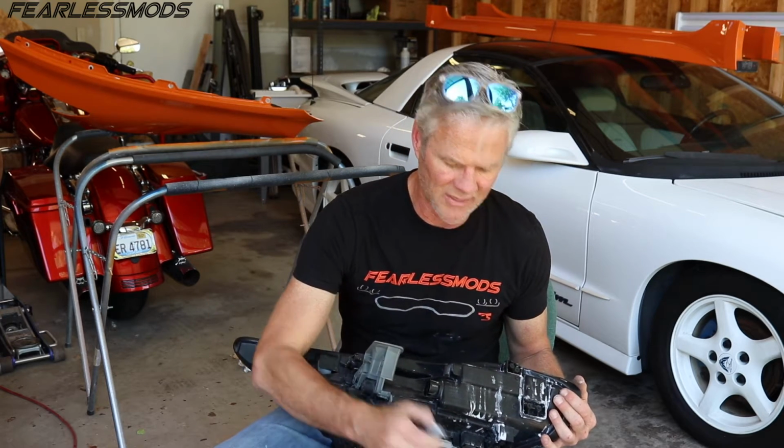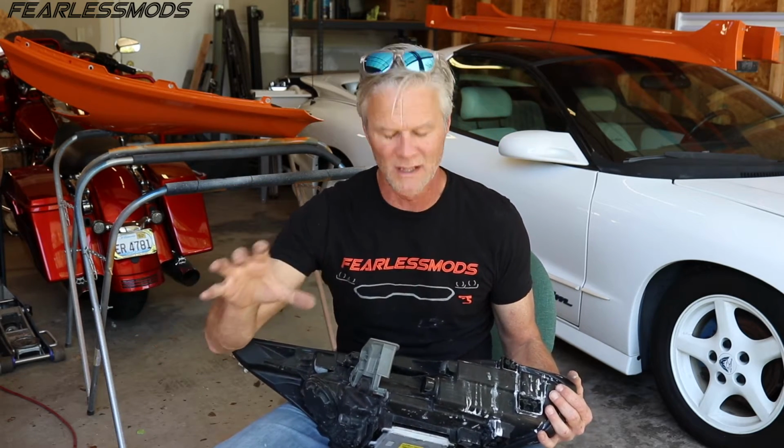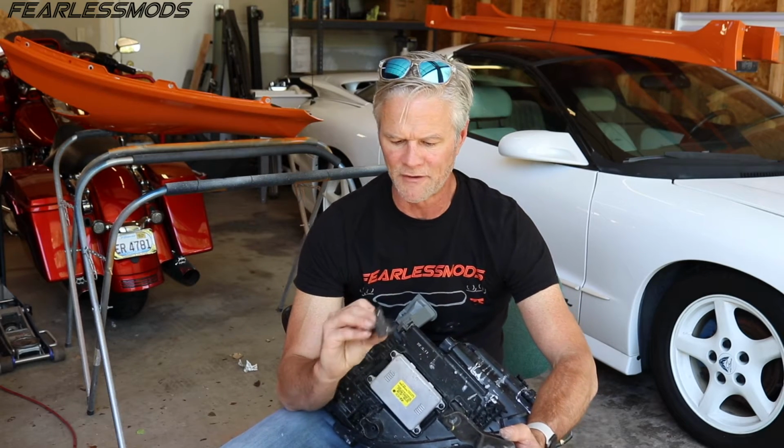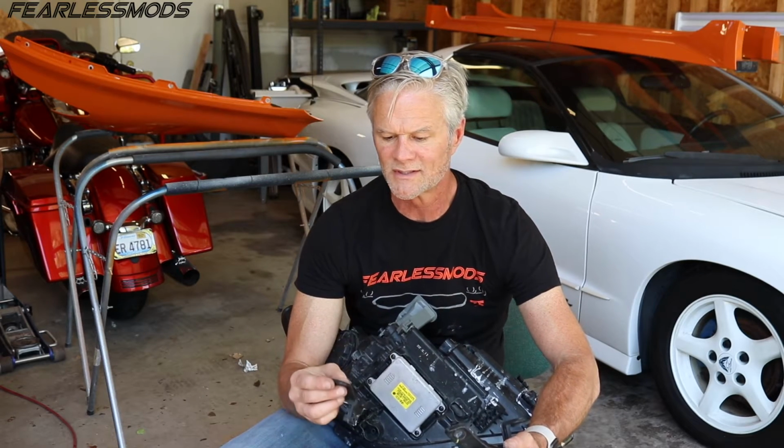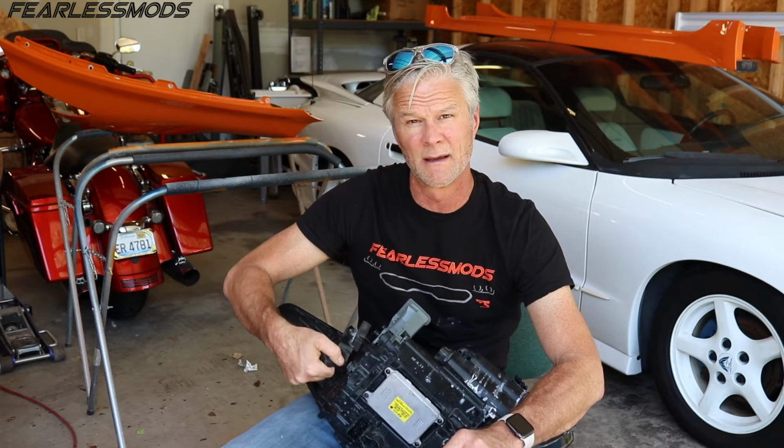And in addition to that, you have two clips that go in and actually secure to some receiving clips to really keep it tight. I might prefer to just elongate those holes by that amount so that it gives me the movement on the tip of the bracket, as opposed to modifying the socket connector that mates to the headlight assembly. Why does that side need to go in?